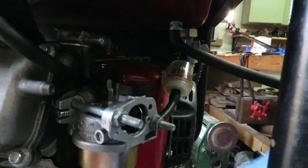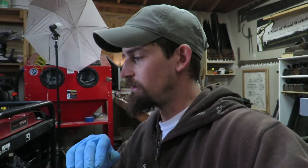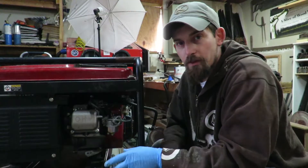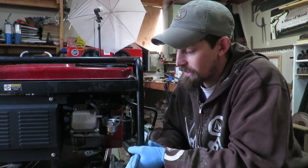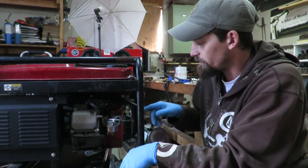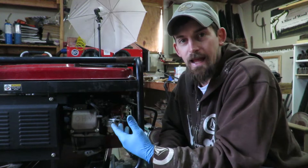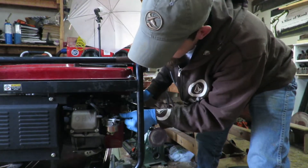We're almost there. As I was doing all that, you can see I have a light in the background — it's actually plugged into the generator right now but it's not turning on. I don't know what happened between the other day when it was turning on and now that I've got the engine running, it's not. I've got a few little bugs to work out. One thing I kept reading is that every time you have an engine that's not starting, everyone says it's the carburetor, it's the needles, it's the jets — but this is a brand new carburetor. I cleaned it twice, it has a brand new fuel filter. I knew it was something else, and I believe it was the gaskets.